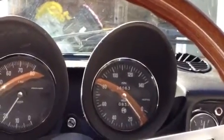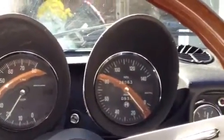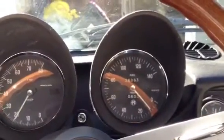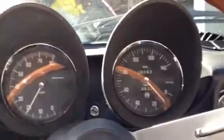Really the only thing that required adjustment was the fuel cutoff solenoid, so I adjusted that one. I can't remember if it was set too rich or too lean. But I wasn't quite happy with the adjustment, so this morning I went right back through the Spica tune-up. I started everything from square one. I ended up just taking the fuel cutoff solenoid out, took it all the way out, then put it right back in and turned it nine and a half turns, which is what I saw on the forum to do. I've been more satisfied with the results of that.